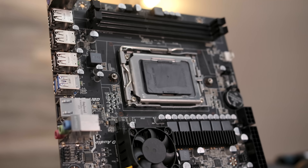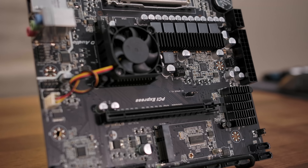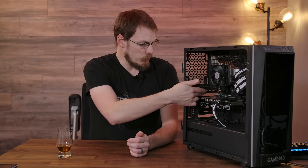Issue number three: you might notice this is not the case I said I was going to use in the intro, and the montage was cut a little short. That's because this motherboard is not a micro ATX motherboard as was advertised in the listing. In fact, this is about half an inch too tall to fit in a micro ATX case — you would need a case with a fifth slot, which is kind of rare these days. So in the end I have all this empty space that I can't even use, can't plug in any more expansion cards, and we're already losing a slot because the chipset heatsink sits so far down.